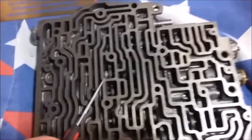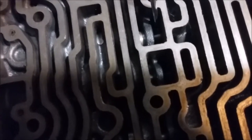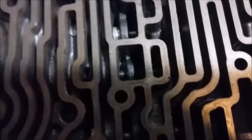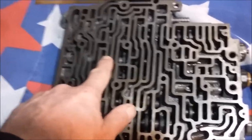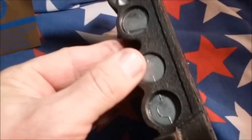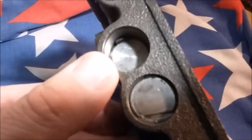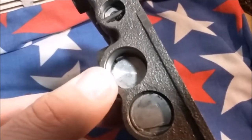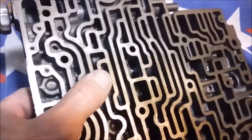Let me zoom in and show you what's in here. This valve body is 86 and later, and it has an aluminum plug in here that looks like a valve but is made out of aluminum, so it only moves a very little bit and just blocks off everything. So there are two different valve bodies already: one with the steel valve in the lock-up position, and this one with the aluminum plug. If I tilt this up, you can see the 1-2 shift valve, 2-3 shift valve, 3-4 shift valve, and where the lock-up goes. This is the second valve body — 86 and later — and it does not have the steel valve for lock-up; it's just plugged off.